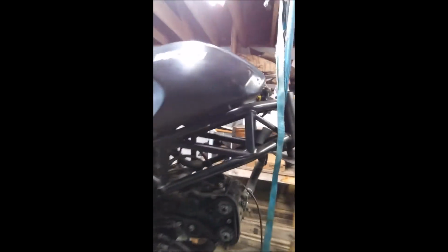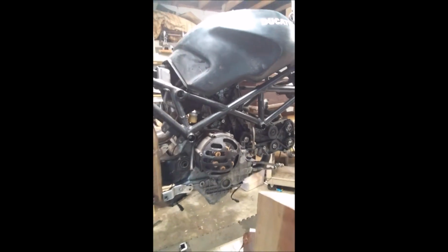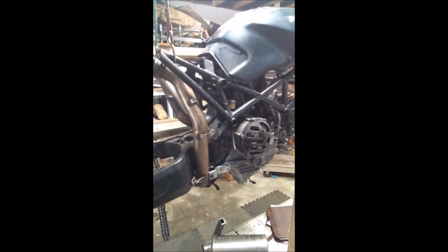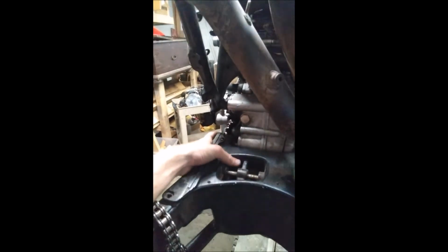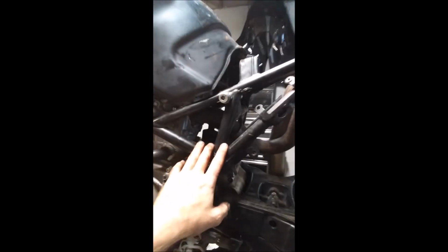But anyway, this is an exciting build. It's about halfway done, I'd say. The engine is in. That's a big part of it. All the rest of it is tedious, small detailed work, making sure I have the right shims on either side of this swing arm, having the correct lineup and geometry here in the frame. We want to get these measurements dead on, so that we don't have a bouncy suspension or an irregular suspension. That's not fun.